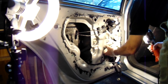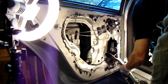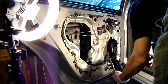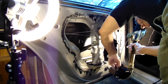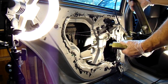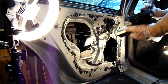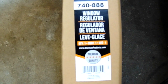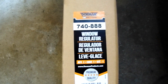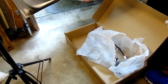Now we have easy access to remove the window regulator and motor assembly through the right side of the panel. It comes out relatively easily and all we have left to do is disconnect the wiring from the motor. I've already separated the motor from the regulator — it's just three bolts and comes loose easily. Since my regulator was broken I'll be replacing it, though you can also replace the motor if needed. I got a new regulator from Auto Parts Warehouse for around 64 bucks, and it also came with some clips for the door in case you damaged any removing the panel.